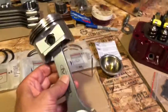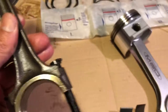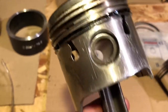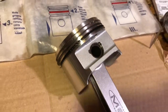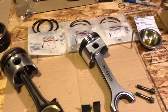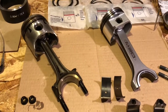But this is how you build a race engine — super quality components. Here's the core race engine that our friend sent us. ARP rod bolts, same size as a small block Chevrolet V8 — that's pretty good. But look at this piston: a four ring piston with these huge open skirts, just asking to be broken off like a graham cracker. The weight of them and the drag of these rings — no. Here's how you do a race engine. You can get slipper pistons and spend ungodly money to build something that will live for a few minutes at stratospheric RPMs. We prefer to build these where they make power and torque in a range that lets them survive a race or a season or two.